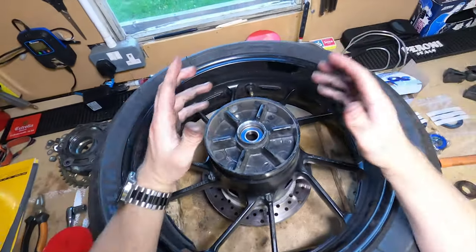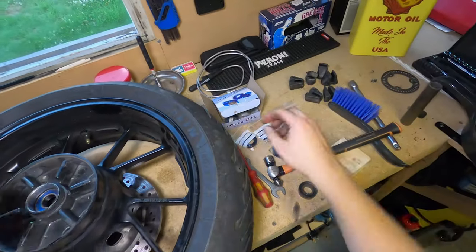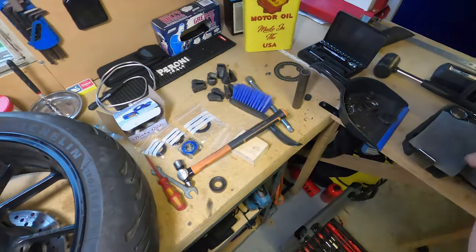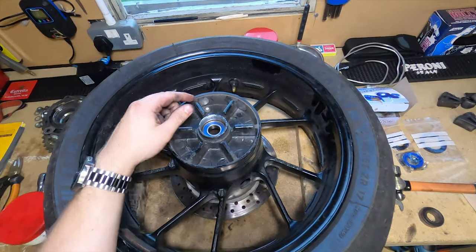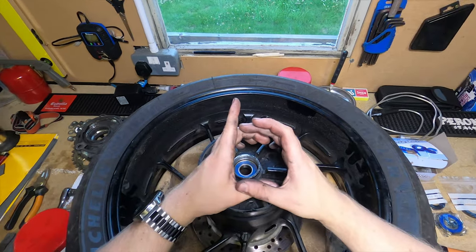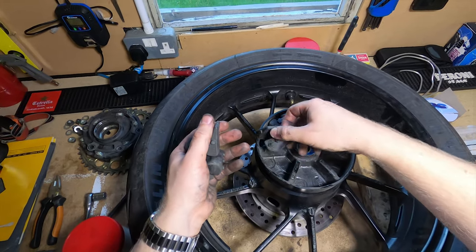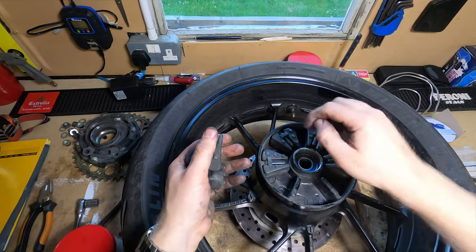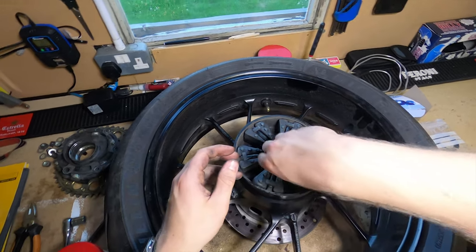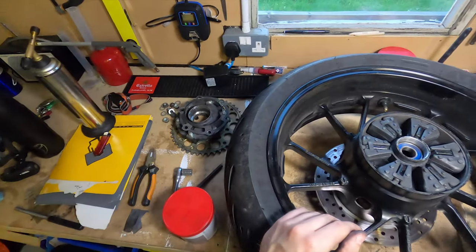And then essentially you repeat that same process for all the other sides. Do bear in mind the sprocket bearings will differ in size, so you'll obviously need, that was the biggest socket set that I actually had, so you can buy seating kits, like bearing seaters. That side you've got the cush drives, which go in there. You want the rubber bridge bit at the top. You can't physically put it in the other way, and if you can, well done.